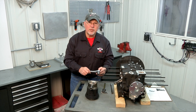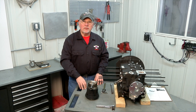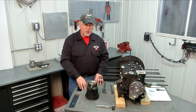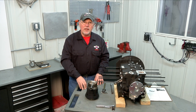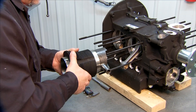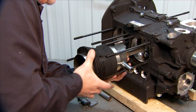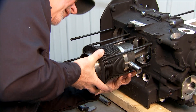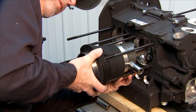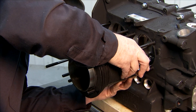It turns real free right now so it's pretty easy to do that. Later we'll use our chart to convert our deck height into a compression ratio and we'll talk about the spacers that go on the bottom of the cylinders to set the proper deck height for the proper compression ratio. So the first thing we do is install temporarily our cylinder and piston on a rod. We've got the rod at top dead center already, and we'll check that as soon as we get the cylinder installed on the engine.